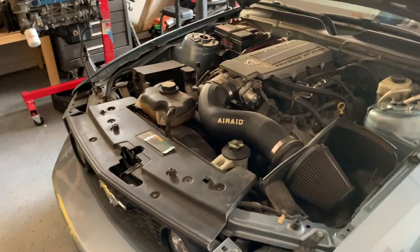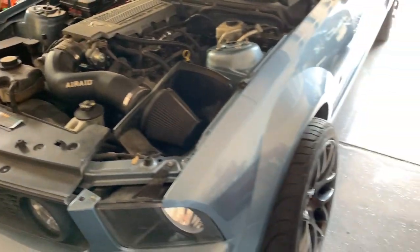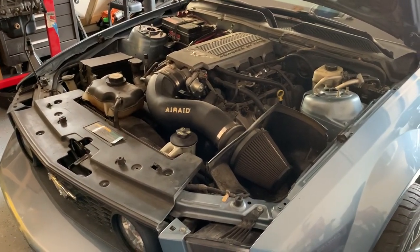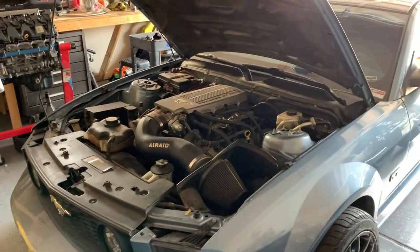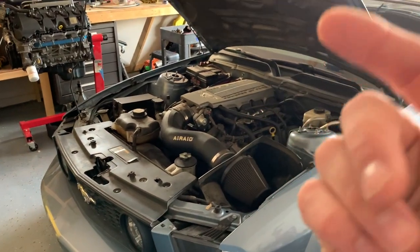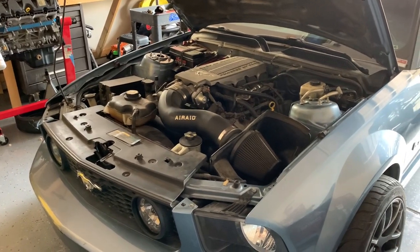As you may know, I'm a pretty big advocate of electric steering, especially since the one on my Fusion worked perfect. So I think this is a good upgrade for all you S197 drifters, the early ones. And it can even apply to the 11 to 14s if you just throw a Cortex Racing controller at it — it'll act like a hydraulic rack. It doesn't have too much assist and doesn't have too little assist. It just has the same assist all the time. Feels great. There's no fluids to worry about, no overheating of fluids, no leaks, and it just simply works.